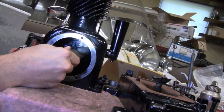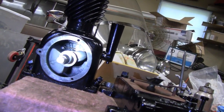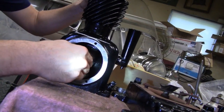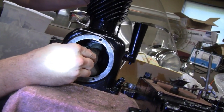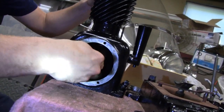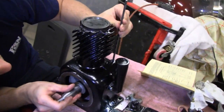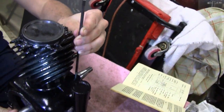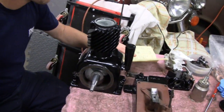You can see my finger in the back. I was talking about a hole — that's where the rod goes in. So basically when your piston starts coming up, your pushrod's open to let out the exhaust gases. It'll be a lot easier if they'd marked it — a dot or something, anything to help out a little bit. You don't have the piston hooked up yet, so you don't know if it's top dead center. You're going to go by the valves — the pushrod, I should call it.